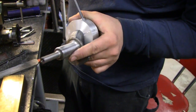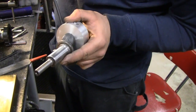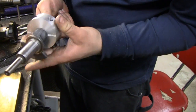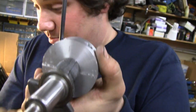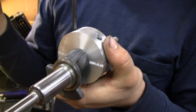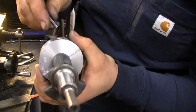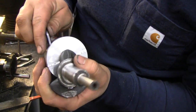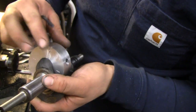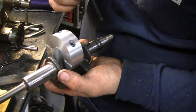We're just test fitting the two shims real quick. Keep them straight. You're not far off. So they're snug — it's locked on the crank right now, and you can see I can still shift that one a little bit. This one I tightened all the way, so you can't even see it. So that brass is actually going to be too thick. I'll use the brass and just file — I'll cut two shims out of the brass, one for each side, and then file the aluminum shims to the correct size. And then that'll be done. It's still a little tight. So, connecting rods next.